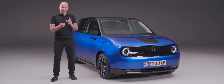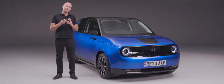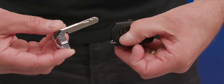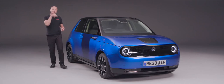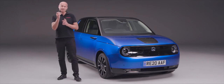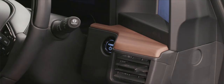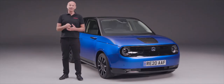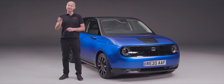One thing to note on your key: it has a battery inside for the remote. If that battery has gone flat, you can still get into your car. There's a little release catch on the back of the key fob which reveals a blade inside. You manually pull the door handle open and pop the key into the key barrel hidden discreetly behind the handle. Once inside, you hold the key fob over the power button — it will energize the fob, recognize it as your key, and allow you to drive to your Honda dealer to get a new battery fitted.